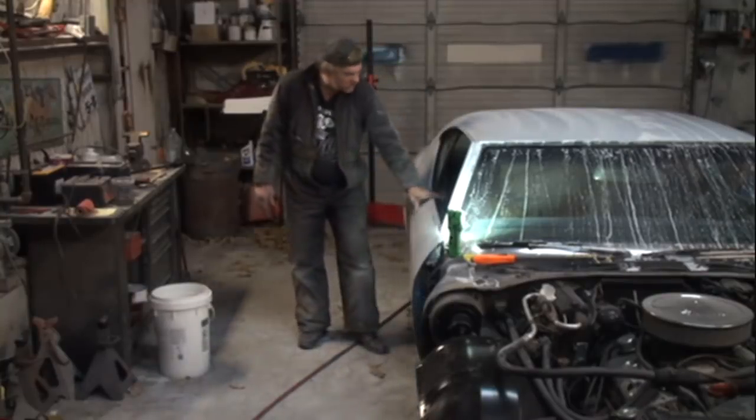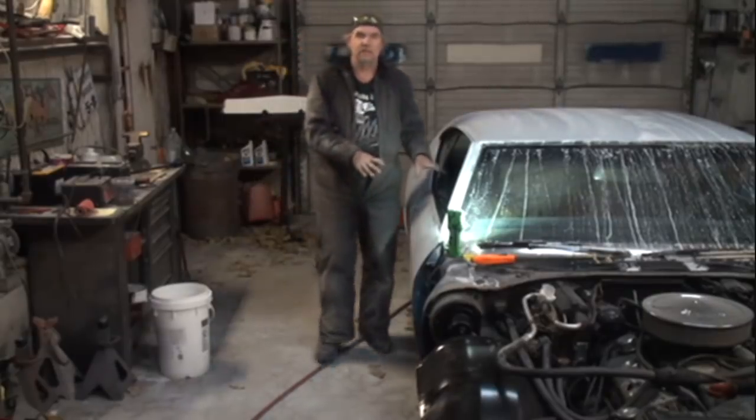I'm going to go ahead and close the door just like that. I want it latched, all right? And if you do this with the door open, you might want to get somebody to help you out, hold the door, or have a floor jack underneath the door as you're doing it. Once the hinge pins are removed, the door will be sloppy and fall out. I would hate to see you drop your door, break your glass, dent your door, and have to refinish your door just because you wanted to replace the hinge pins.